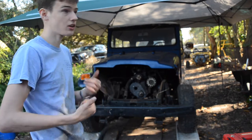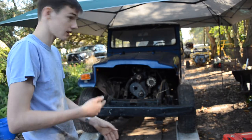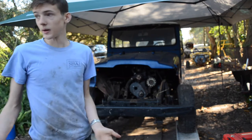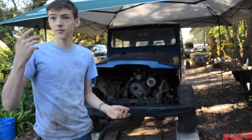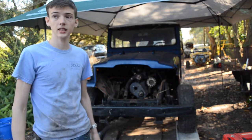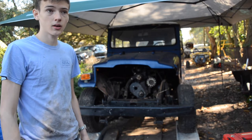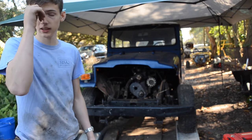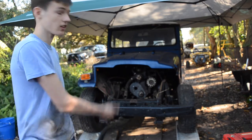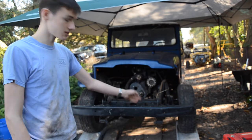I could get the pistons out, hone the cylinders, put new rings in it, things like that, and really get in there and clean all that crap out. But yeah, the environment I have, I don't have a garage. It's gonna be a mess if I do it that way. So I was thinking about it last night. I think what I'm going to do is just drop the crankshaft out of the motor so I can actually get some access underneath there and really get it clean to the best of my abilities, because I don't even have a lift. I mean, I have a jack, but it lifts it about as high as these car ramps do. So